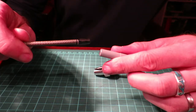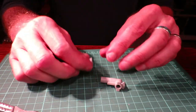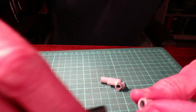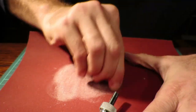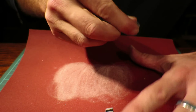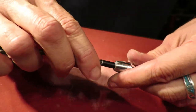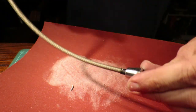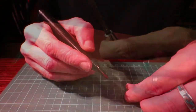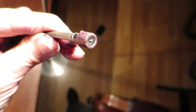The end cap for the cable was too thin for the barrel adjuster, so I decided to make an adapter from an arbitrary piece of plastic. I have no idea what that gray piece is, but I found it and it fit the end cap perfectly. I sanded down the outside of the plastic adapter because it was too wide for the barrel adjuster, and then I used a permanent marker to make the gray black so it wouldn't be visible and would fit in nicely with the end cap.